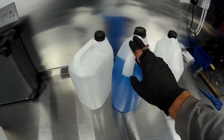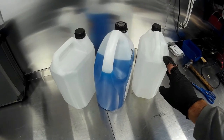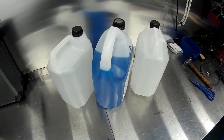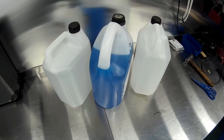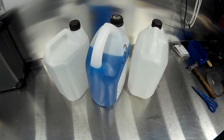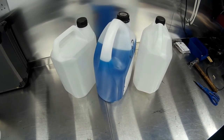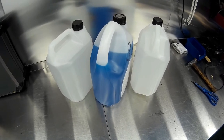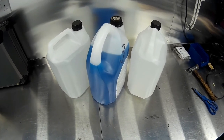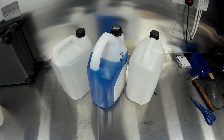When filling up the coolant system, make sure you use a good quality blue antifreeze and deionised water. Deionised water prevents scale and corrosion within the coolant system. The E39 M5 left the factory with blue antifreeze and takes around 12 to 12.5 litres of coolant mix to completely fill the system from empty. If you want to flush the system, flush it through with 10 litres of deionised water, drain off the old coolant, then fill it with fresh coolant in a 50/50 mix of antifreeze to deionised water.